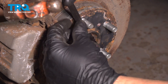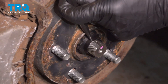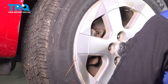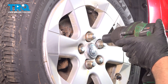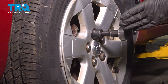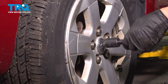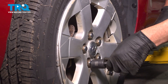Right there where the groove is, we're just gonna take a punch and a hammer, line that up, and just tap it — just pin it over to prevent it from loosening up. Throw the tire on. Snug those down. I'm gonna torque the lug nuts down to 80 foot-pounds in a cross pattern to tighten the wheel down evenly. Go around again and double check.